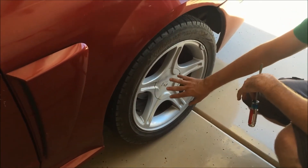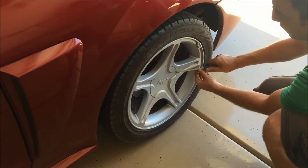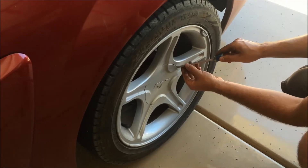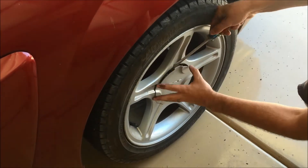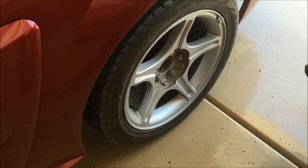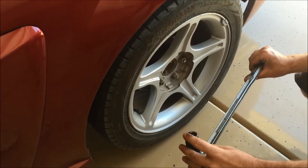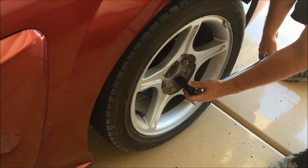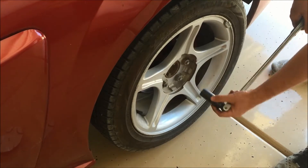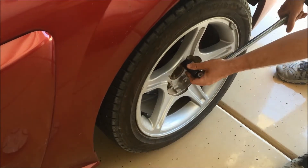The first thing you want to do is break the lug nuts loose. On some of these you have to get a screwdriver in here and pry forward to get the lug nuts exposed. If you have bullet wheels or cobra wheels or whatnot, you may not have to deal with that. Take a 13/16ths socket and break these loose — not taking them all the way off, but while the car has weight on the wheels, it just helps to break them loose.